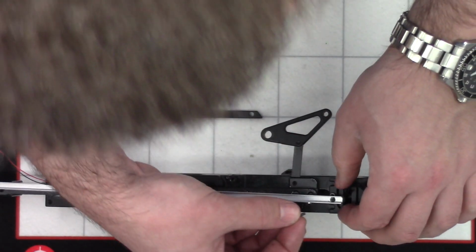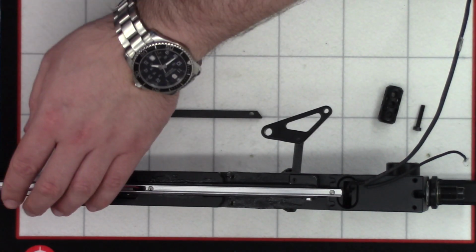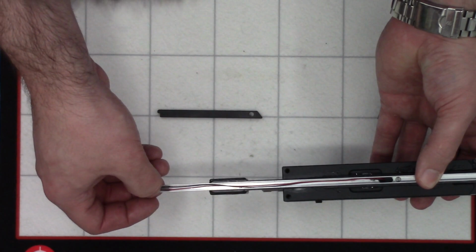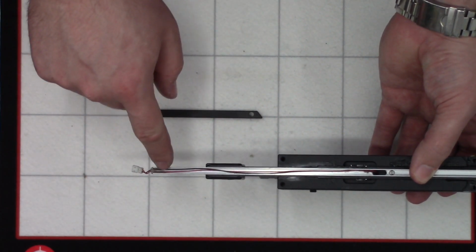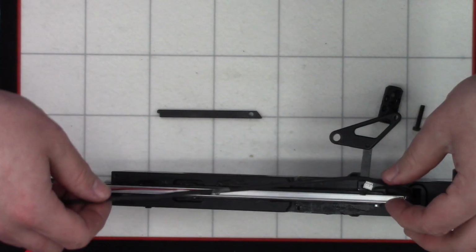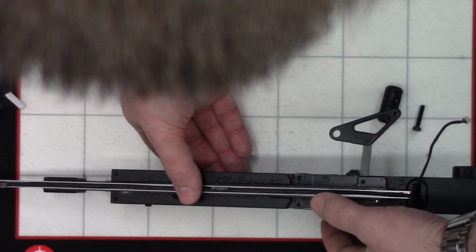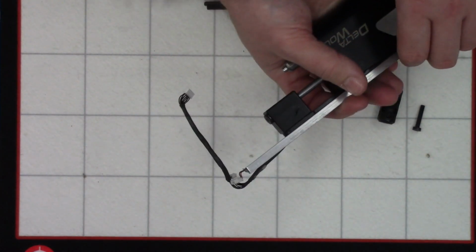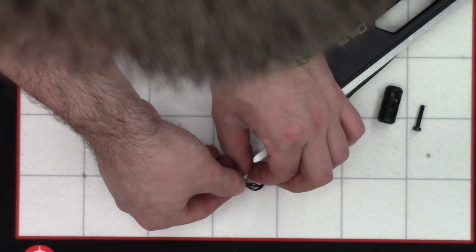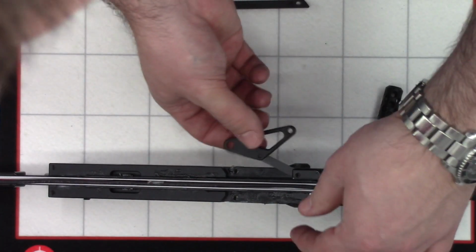Next, we'll add the little screws back in, and then using a flat-bladed screwdriver, we'll do them up. Next, we'll lay the wires in where they need to be. So this one needs to be pushed in the back here. There is still a small amount of hot glue from the factory. We're just going to leave that on. And next, we're going to lay the main wiring harness over the top, the wire in the hole there. Then finally, at the back here, we're going to reconnect the cocking switch to the harness. Nice and carefully. There we have it. Right, that's that done.